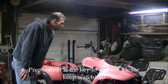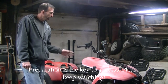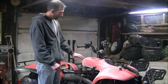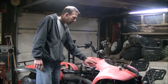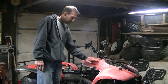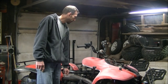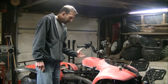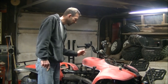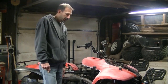I watched videos and read several posts. What I ended up doing was taking all the plastic off. I had decals on here and they were starting to peel off. This thing is 22 years old — I didn't want to wrap over that because it would probably show through the wrap. I also took 220 sandpaper and sanded all over the plastic to get rid of the oxidation and the road tar.